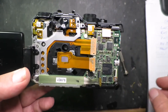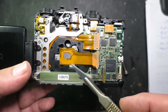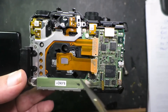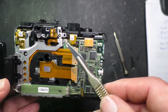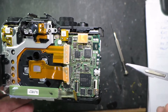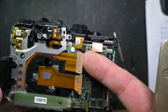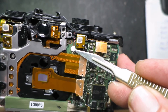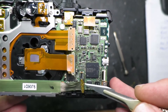What I'm trying to work out now is how to remove this metal plate, which seems to be covering where the screws that support the lens are. They unclip relatively easily. There are screws on the bottom, then the screws for the LCD, and another screw there. Where it gets more interesting is in the corner where the metal goes underneath the circuit board — so I think that circuit board has to come out. I've unclipped it. The main challenge is a very small connector with two very fine wires that needs to be removed along with the screws supporting the circuit board.